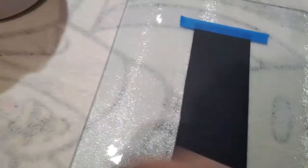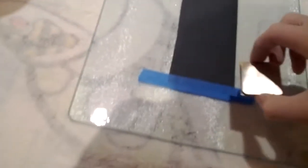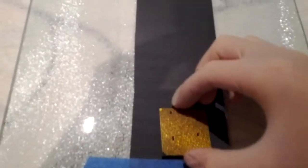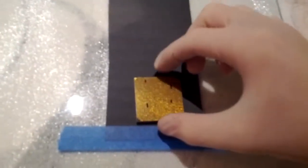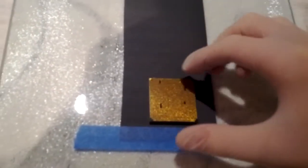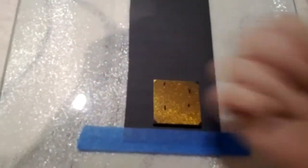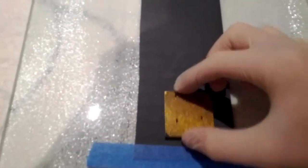And you get the processor, flip it over of course, and start with the arrow pointing to that side. Then I just start at the bottom. You don't put any weight down on the CPU — you just kind of move it with your hand. I'm wearing a glove by the way so I don't get oils onto the pins.